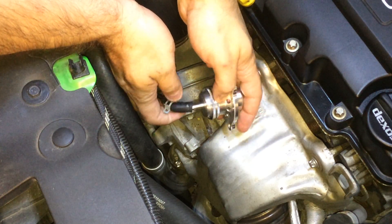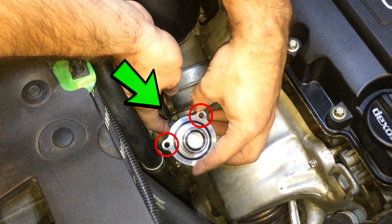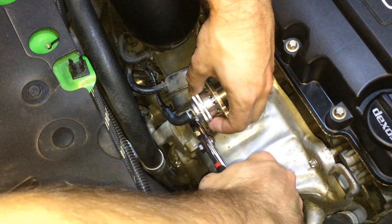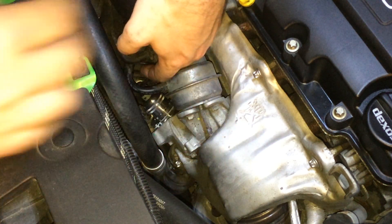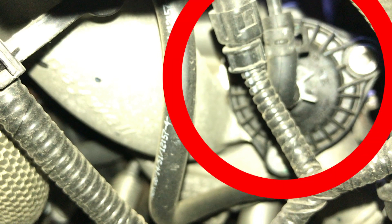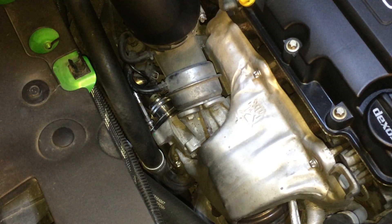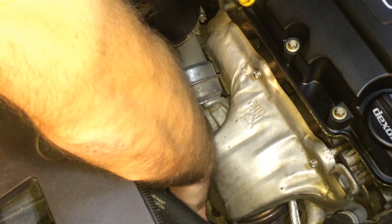Connect the vacuum line to the valve, orienting the bend between two mounting holes like such. Using pliers, squeeze the ring clamp and move it up to the valve. Maneuver the valve into position, keeping in mind the elbow bends upward and slightly forward as seen in this earlier clip. The forward most screw is easiest to install because it can be held in place while threading it. Push the valve into place to eliminate a difference in surface angles. Don't fully tighten it down yet.